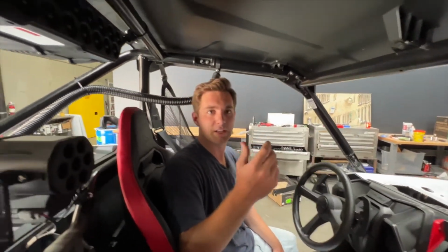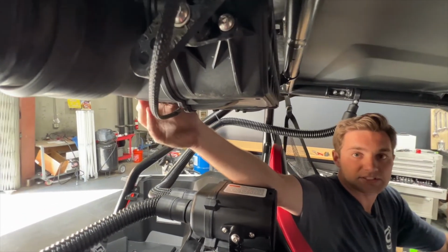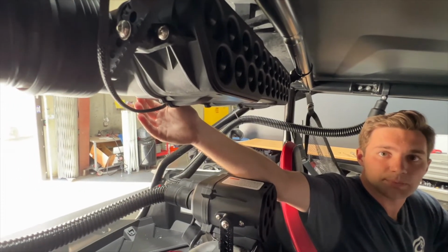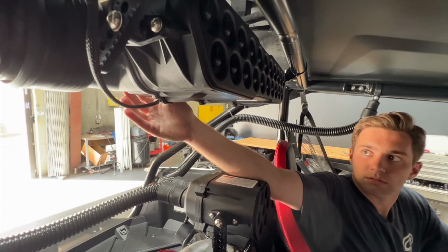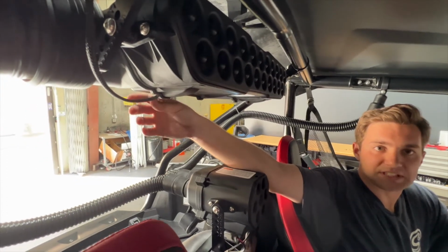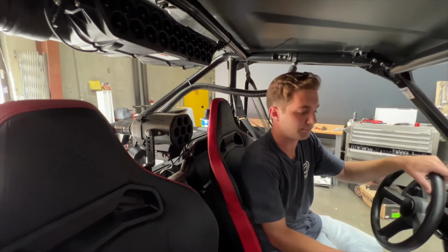And you should hear the fans pick up a little bit as it's now picked up that the engine's running and it sees the RPM signal. The final test is going to be to go ahead and rev the engine up and see if the fan speed increases with the revs. So we can see that the variable speed is functioning properly, and we can go ahead and start putting the car together now that we know everything works correctly.